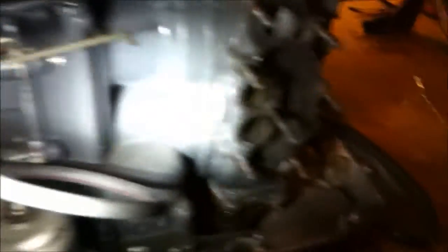Let me go through what I've done so far. I've taken the intake manifold off — the carburetor and manifold come off as one piece. One thing I do when taking things apart is put them into containers in order, so I know what order they came out and go back in. Here's a container that has all my carburetor parts, hoses, and some of the bolts.